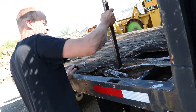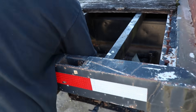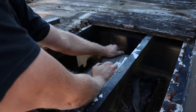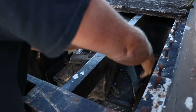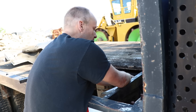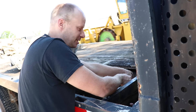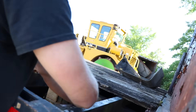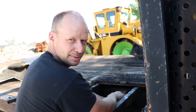We need some access to the batteries — they're down here. We have one maybe good battery that might work. I have my doubts. Is it green? It is green. Let's see if one battery is enough to start this thing in the middle of summer. These do not have a grid heater or glow plugs, so you're relying completely on the engineering of the International team. One battery — let's see if it does it. It's normally three batteries, 12 volt. Depending on how long it's been sitting, the top is open so the exhaust is probably full of water.